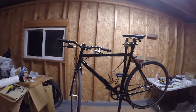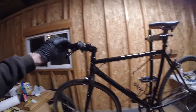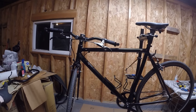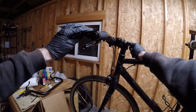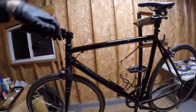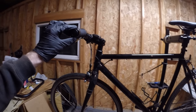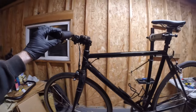I'm also going to replace these handlebars with bullhorn handlebars. Here are the bullhorn handlebars. So what do we need to do? We're going to remove the cables and do new cables. We're going to remove the bars, and I'd also like to replace this stem - currently 80 millimeters long - with a 100 millimeter long stem, a longer stem that will stretch me out more on the bike. I might also do a different angle, maybe flip the stem. We'll see.